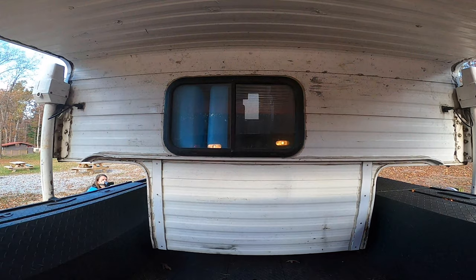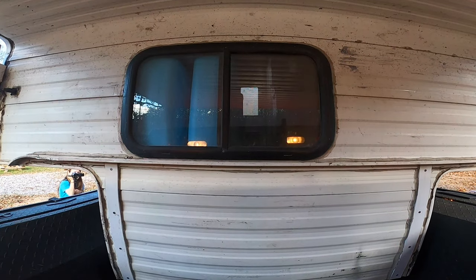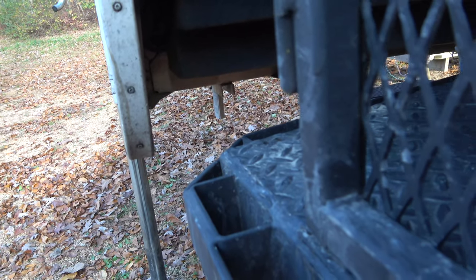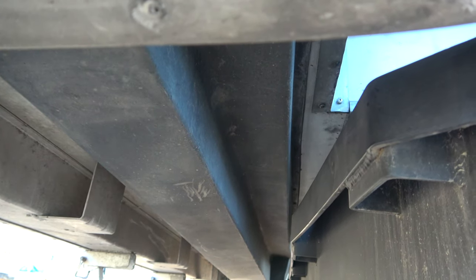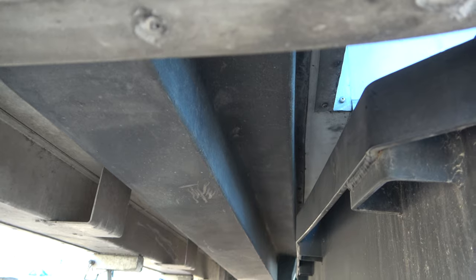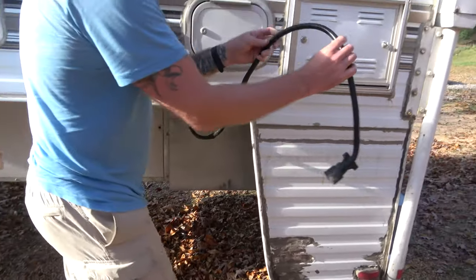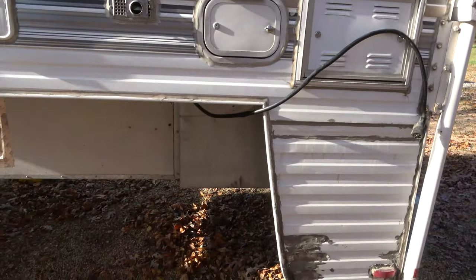And if you have a dually, you'll also want to have dually brackets, which will have the extra clearance for you when you're backing your truck beneath your camper. Now you want to slowly back your truck until the camper is flush with the truck bed. If you have a standard bed, you may or may not have to remove your tailgate depending upon your camper — be sure to check with your camper specifications. Also be sure to check that your camper electrical harness is clear out of the way of the truck and the camper.